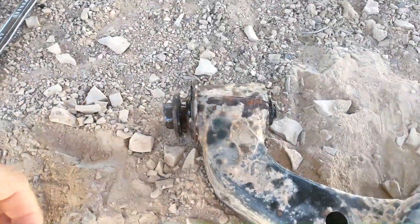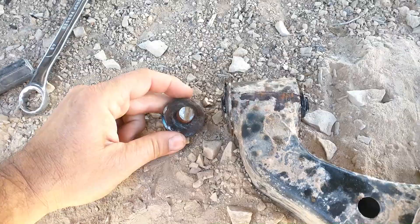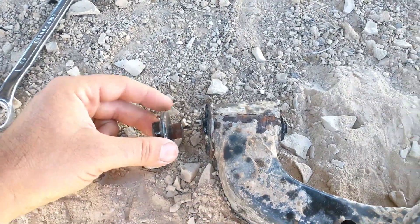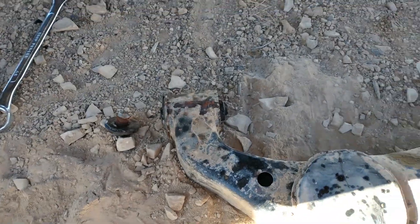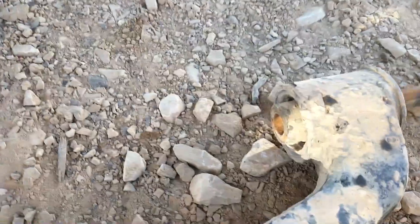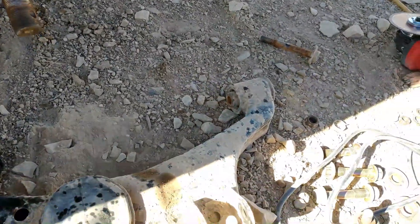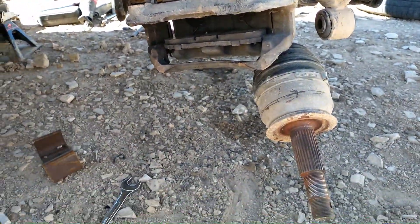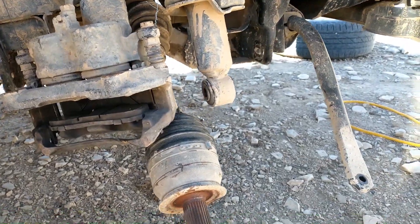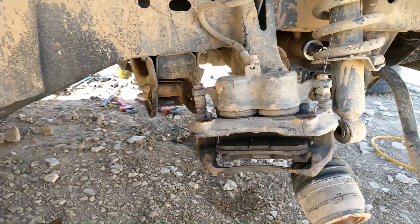One other reason I'm replacing the control arms: the bolts were all seized. I had to cut them — I tried a press, an air hammer, and beating them with a sledge. I only got one of the four lower control arm bolts out, and even it doesn't look great. Part of what's holding me up is waiting on UPS to deliver a new set of bolts. The upper ones all came out, but the lower ones didn't — probably salt water got crammed up into them.